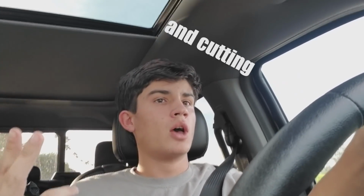With proper bump stops, proper offset, and flat fenders or Metal Cloak overline fenders, you can run 37s with no lift. Will it be practical? No. Will it flex a lot? No. But there are people who run 37s with no lift. AutoEdit, big YouTuber, he ran that setup for a long time.